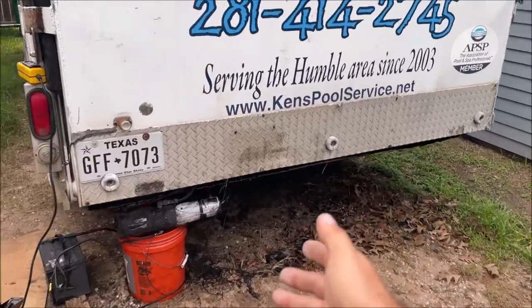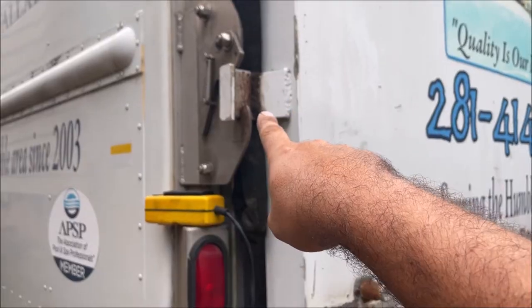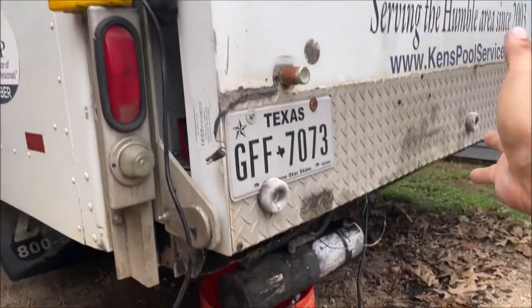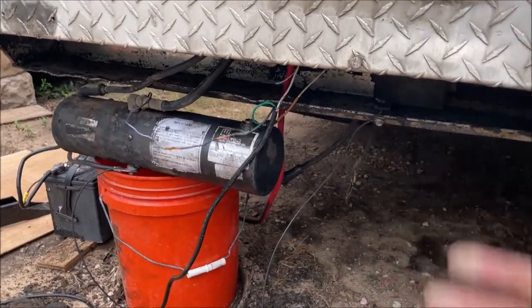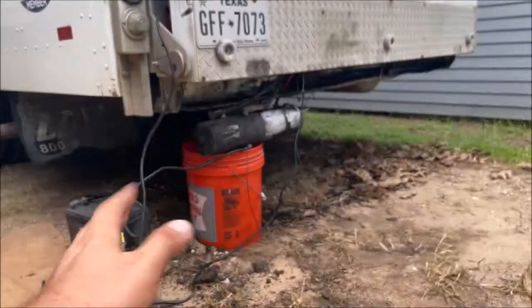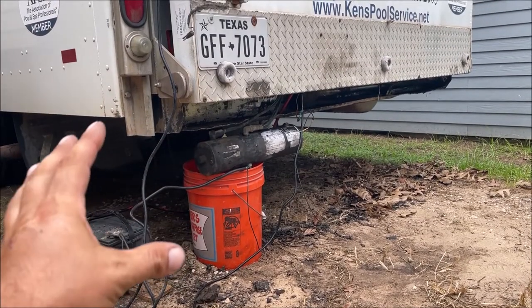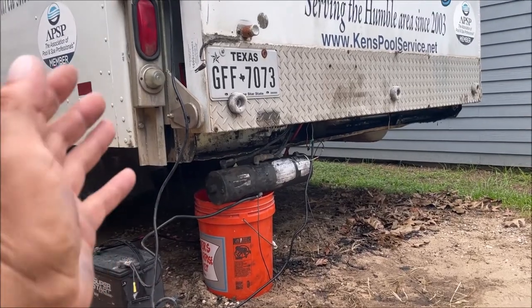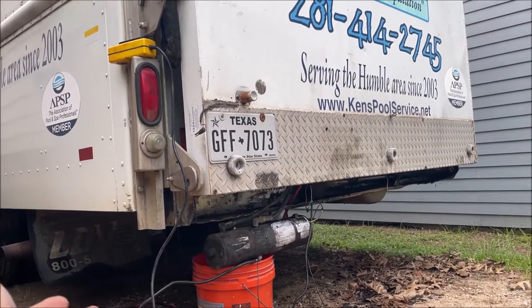Everything for it is under the lift gate. This one has safety latches on both sides, so I was able to go in there and pull everything out. I had to get the motor out and the pump because I needed to check the fluid level — there's a little cap on top. The wiring was completely shot, so I had to rip everything off. I have it rigged up right here so we can operate it before we go in deeper and start rewiring and cleaning everything up.